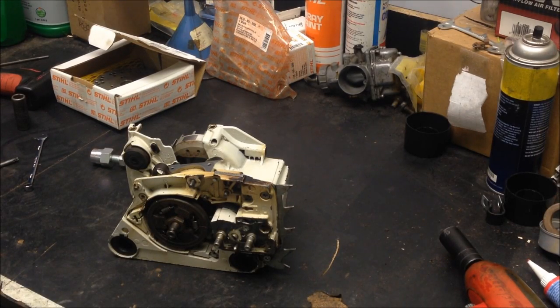What's going on, guys? I got an MS360 here. That's an 1125 with flippy caps on it, that we're going to split the crankcase on today. And it's got a couple things on it. We've got a flywheel and a clutch on it. So I thought it'd be a good opportunity to show you guys how to pop them off the easy way as well. I'm going to start by pulling the clutch off of it, and then I'll spin around and do the flywheel.